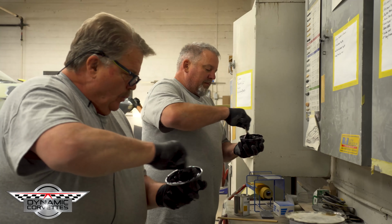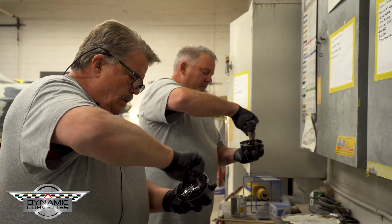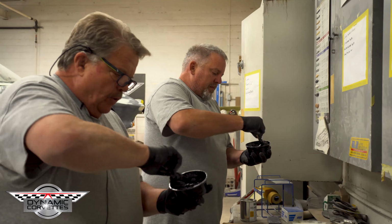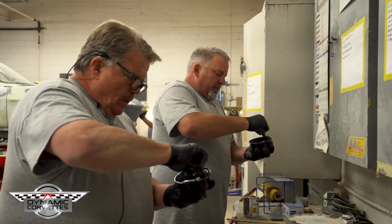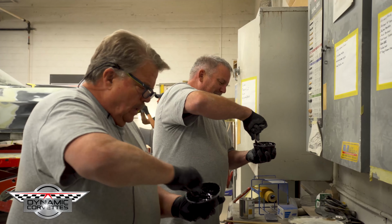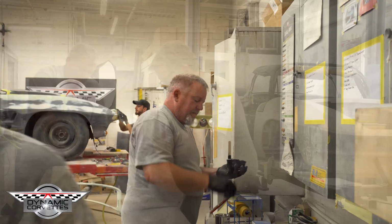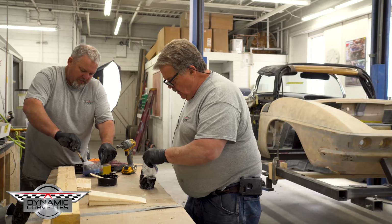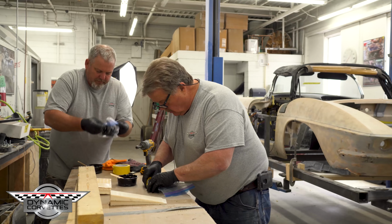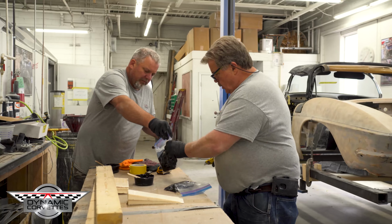The pot life on this, today it's about 65 out. Probably have a good 15 minutes before it starts to kick in the bag. Once you spread it out on the floor, pot life is going to be longer because it's not in the mass that it's going to be in. So we put our epoxy in a heavy duty freezer baggie, put a little vent hole at the opposite end of where we're going to come out, and put a little cut in there about 3/8 of an inch.